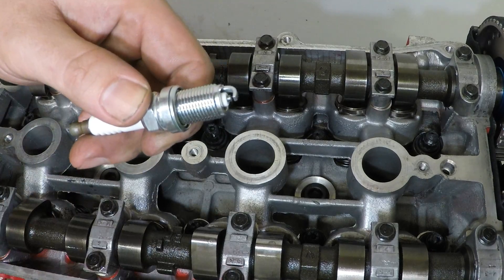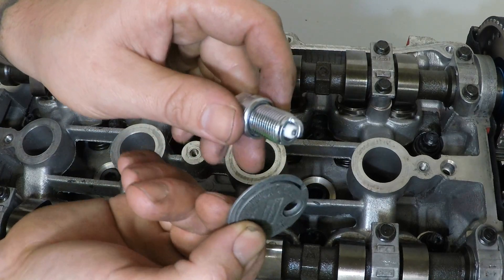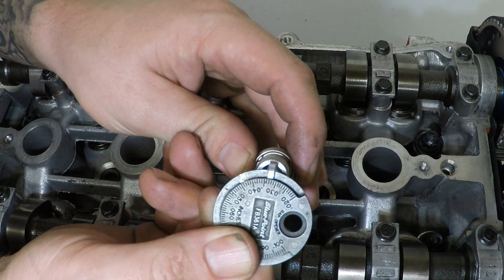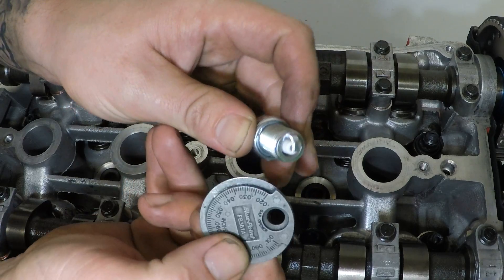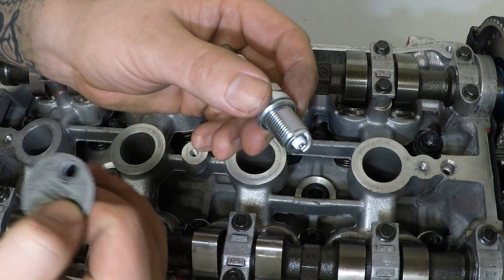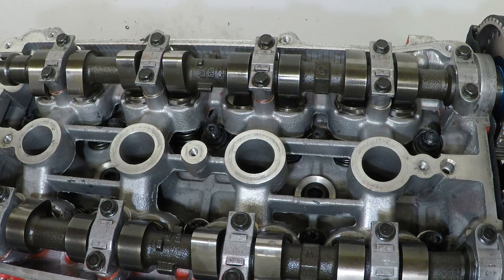There are a couple of different ways to do this — you could use feeler gauges, wire gauges, or what I like to use is a gapping plate. To do this, all you do is slide the tool in between, and as you can see this is at 0.032 of an inch. If it was too little you would use the opener on the end and twist it up; if it was too big you would just tap it on a soft surface like a piece of wood until you get the desired gap.